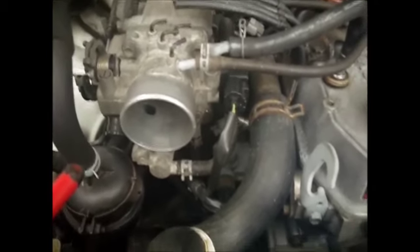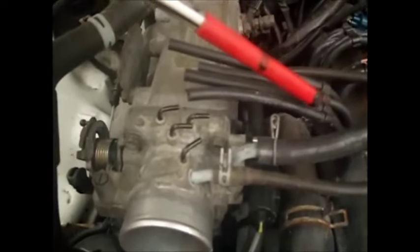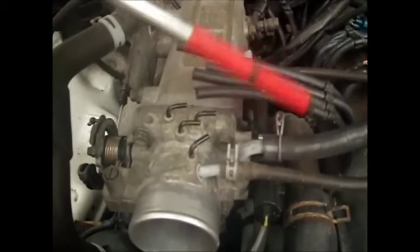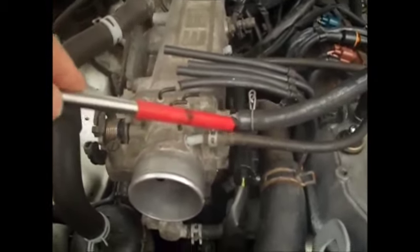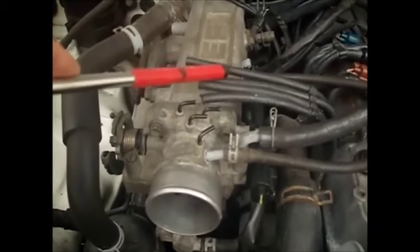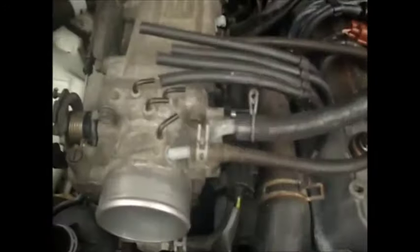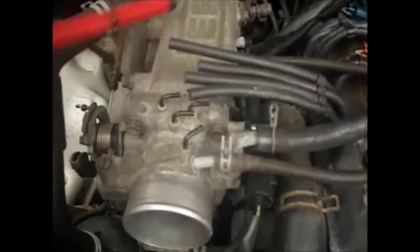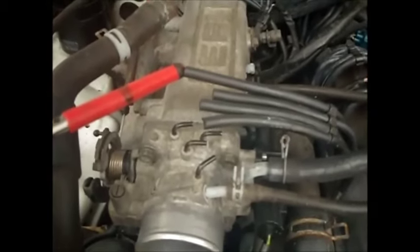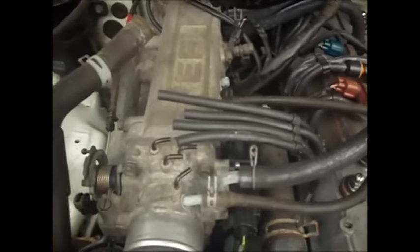So next step, I've taken the vacuum lines loose. These little ones are easy to put back if you haven't ever moved them, because they always lay flat across here. They just fold down and go right back where they're supposed to. These two are different sizes, so they won't fit in the other position. If you have lost these or moved them around, the easy way to tell is to look on your smog diagram up here in your hood, if you have a smog vehicle. It'll show you the routing for these tubes and where the other end of the tube comes out. So if you just blow in this end of the tube, the air should come out where you think the routing is going, and that'll show you if you have it correctly routed or not.